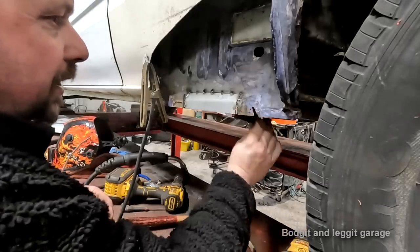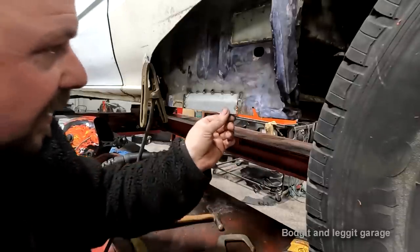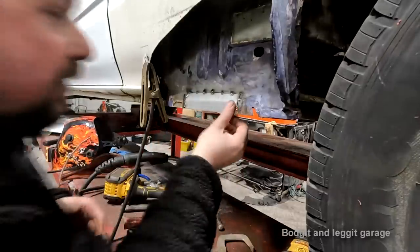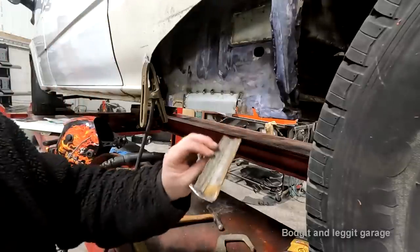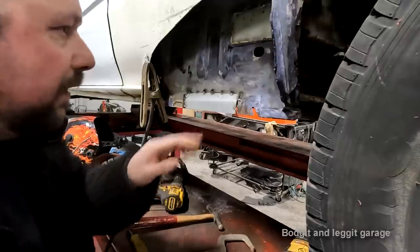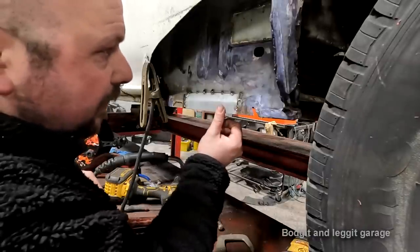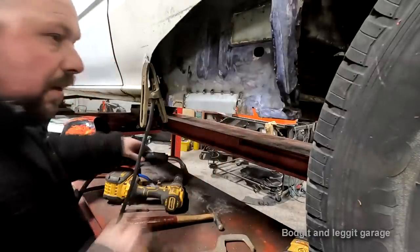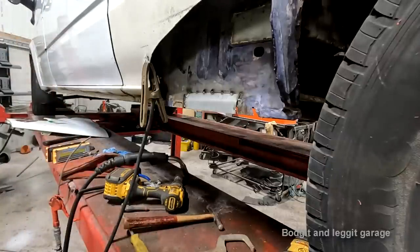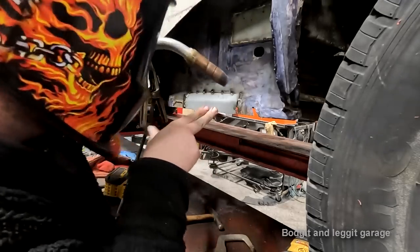Now, completely cut through. See that, look? Old panel gone. This panel, now once I bring it to there, is perfectly in line and we're golden. So, and like I said, we've cut it perfectly to our shape that we need. So what I'm gonna do is get that welded down into there. We've got a 1mm gap, which is what I like. That's just personal preference. It's all up to yourself. I'm using 0.8 MIG wire, so I can get away with a 1mm gap quite easily.